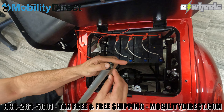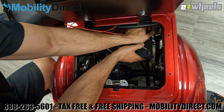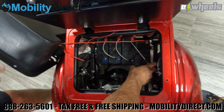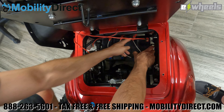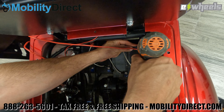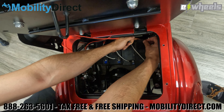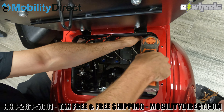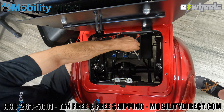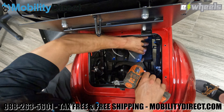That's something you should do if you're taking apart this scooter, so that you know exactly where each bolt and nut goes when you're putting it back together. It is a little difficult to remove the screws tucked in the back — the red terminal screws — because the angle for the screwdriver or drill is just kind of awkward. You may need to remove the battery slightly, pick it up and set it on the higher part of the battery compartment for better accessibility to that red terminal screw. It's a Phillips head terminal screw, so just unscrew each of the connections one at a time, being careful not to let anything bridge or cause a spark.